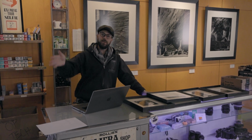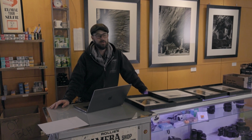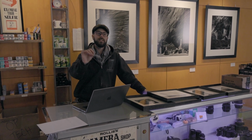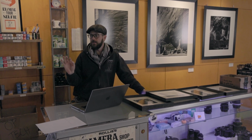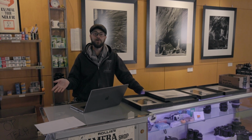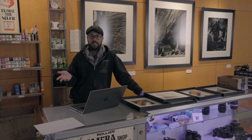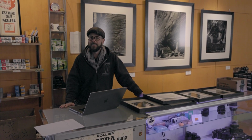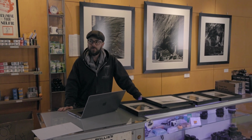And sometimes you get to do it once and you're good, and sometimes you spend literally 8 hours doing a cleaning, doing a check, doing a cleaning, doing a check. Let it sit. That's an important thing for these, at least for these older Epsons. You do a couple of head cleanings, and at that point, you're just throwing away your money. So you want to sit after you've done like 3 to 5 of them for a couple hours while the printer is not doing anything, it just sits. And then you come back for another nozzle check, and everything's fine again. I don't know how that works. It's magic. Sometimes you have to make a sacrifice to the printing gods.